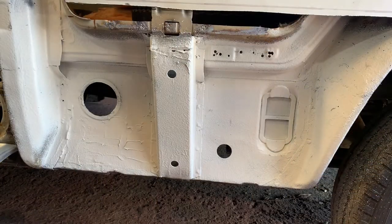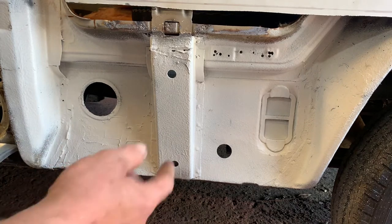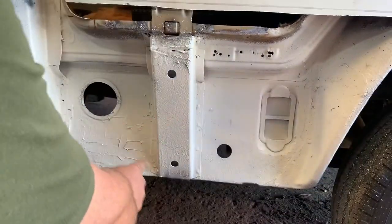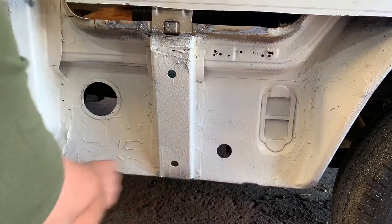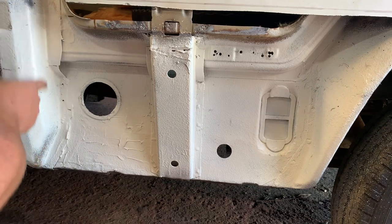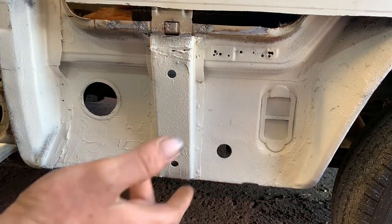So, as you can see, and obviously, this is the rear quarter of an LT, or front of the wheel arch. So we had this piece badly rotten out, or non-existent. This had lost its bottom originally. All of this was really nastily repaired and rotted out. And it turned out in the end that I think this thing has been thumped. It's not registered ever as having an accident, but it's obviously been hit here in this door pillar. This door pillar had been really nastily repaired and was very rusty. So what I've decided to do, or what I have done,